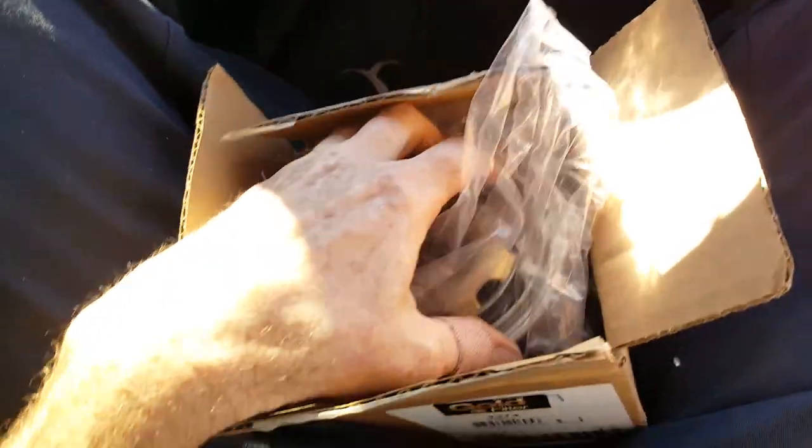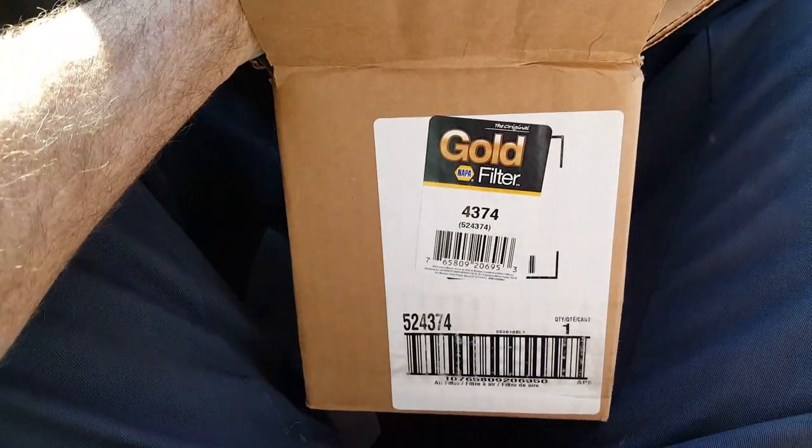On a diesel motorhome, you have a diesel chassis that uses compressed air mostly for braking. That compressed air is taken from the atmosphere, so it's going to have moisture and dirt in it. There's a desiccant-type air filter right at the beginning where the air comes in that helps dry the air out before it gets compressed and goes to the tanks. It's basically an air filter — it looks just like a great big oil filter for an engine.